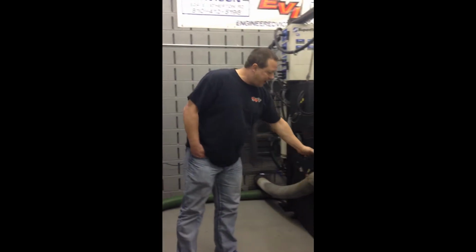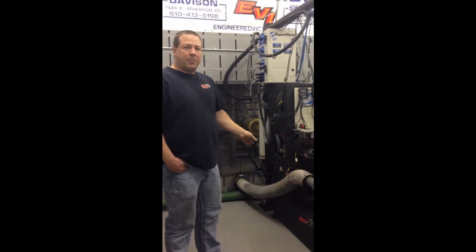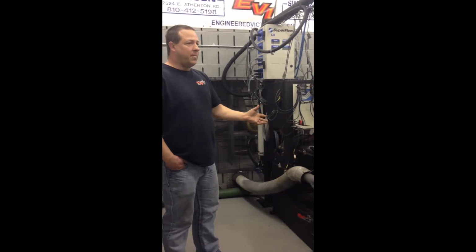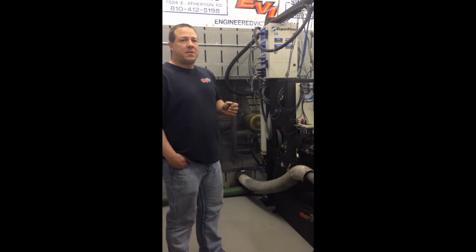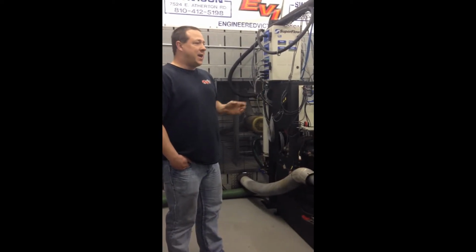Anyone that's dynoed before and has some dyno experience has probably had an exhaust pipe fall off and start putting exhaust into the room, and you'll see on your dyno that you've automatically lost 15 or 20 horsepower, and then you go, oh my god, what's happening to the engine?